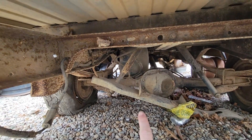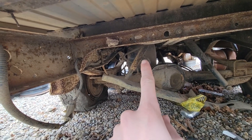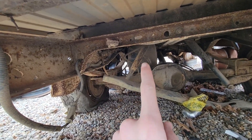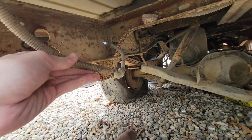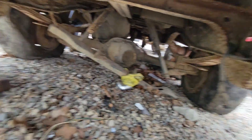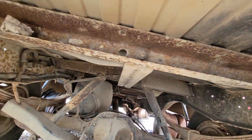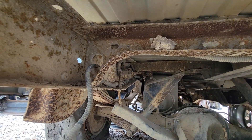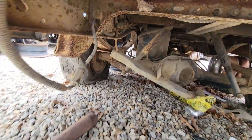I'm going to trace it all the way back up in front of the tank because there are some spliced-in parts up there, so I'm going to take all of it that I can. You can see it's that connection, and then right over here there's another connection that runs behind this piece and then meets in this junction hole and goes all the way up.